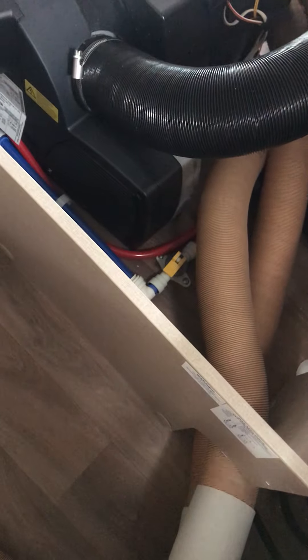Under the bed there's your boiler, and on the floor a yellow tap. That tap is for draining the onboard boiler and hot water system — lift it to vertical to drain the system, and it needs to be horizontal as it is now to run the system.